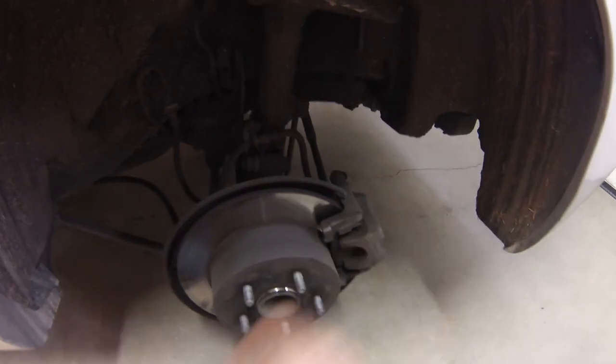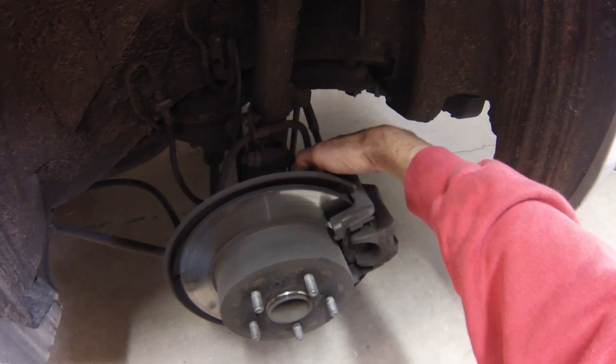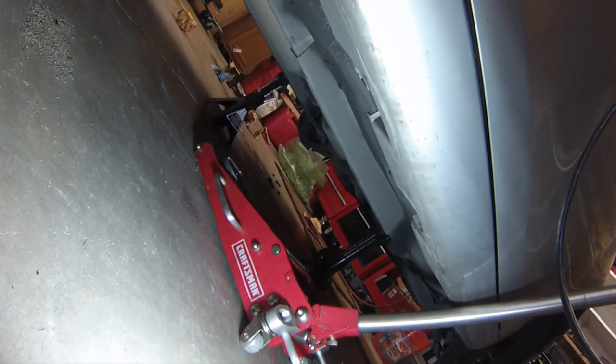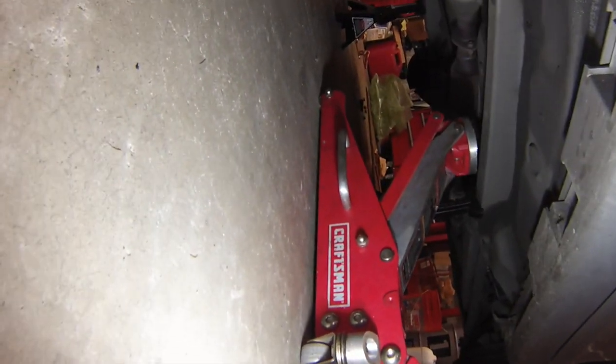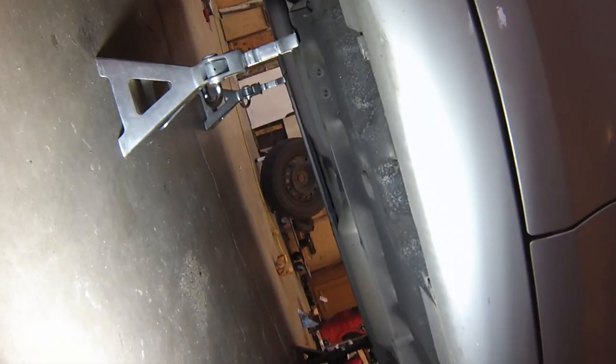When I take the calipers off, I will take them off using the inner bolts, which is basically the same process for removing the rotor, so I'll show you how to get the rotor off as well. The way I got this Camry off the ground — it's got a fairly robust frame rail under here — I put the floor jack several inches behind where I want to put the front jack stand. Then I lift it there, slide in the front jack and slide the back jack in along this frame rail. This car is really easy to get up off the ground.